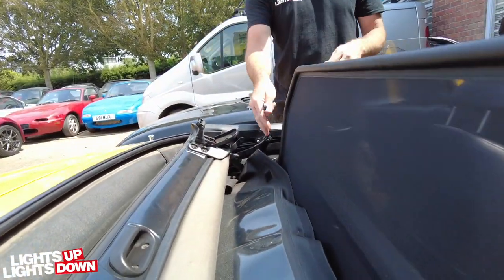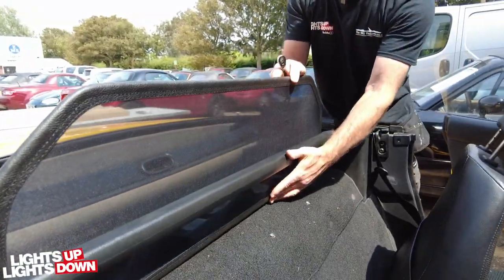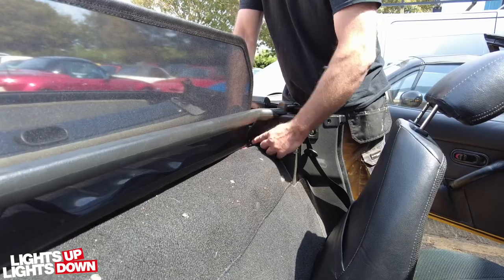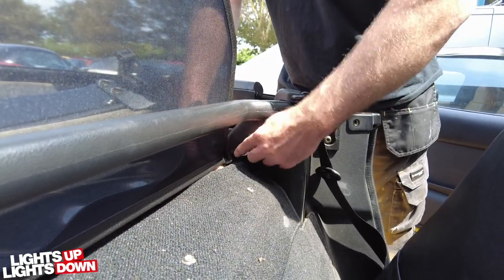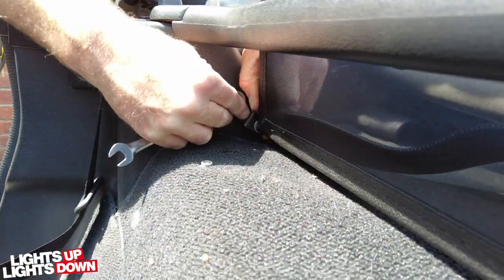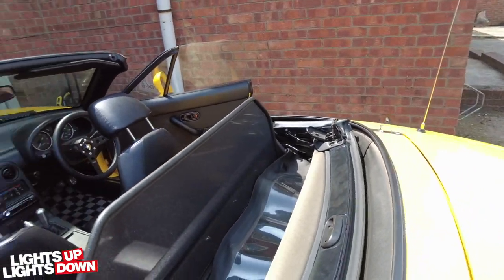What's important here is finding your position. With the brace there, if you go too far back and down it's going to keep flopping down as you're going along. So you want just a little bit of angle forward to stop that from happening — that's what I tend to do. Now I've got it where I want it, I'm just going to tweak up the brackets. These will fight you a little bit because as you're turning them they'll keep trying to move position, so hold it in place. Make sure you've got them about the same on both sides. I'll grab my 12 and 13 mil.